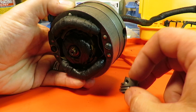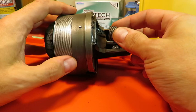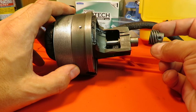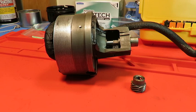And so the thing to do is to get the worm gear and the shaft through it in here, get the screws back on with the A side screw through here and the B side screw resting against the shaft, tighten them both down nicely, and get it all back together the way it was. An interesting thing is, where does this shaft belong along the length here? And one of the ways I assessed that was to use this caliper.